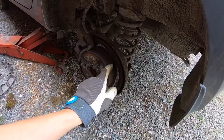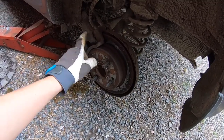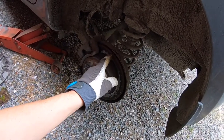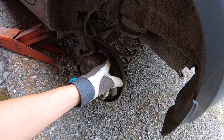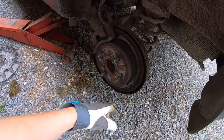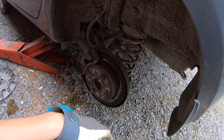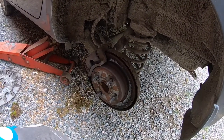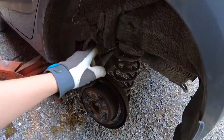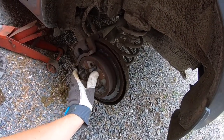This will probably not pass inspection. You can see there's just this area here that the brake pads actually hit, and here there's nothing. The problem is that even if we get new brake discs for this car — it's not that old, not completely rusty — the problem is that she doesn't brake hard enough, so these ones will get rusty in a year and we'll have the same problem next year. They also live on a gravel road, so she'll get a lot of dirt in there.